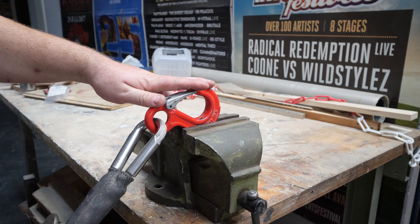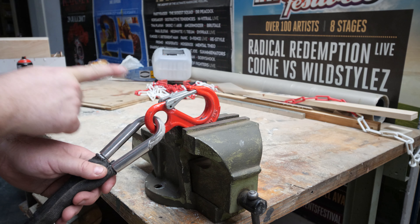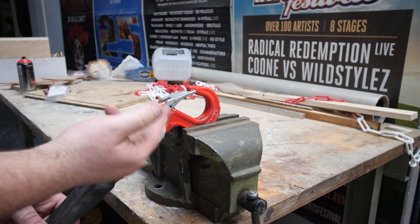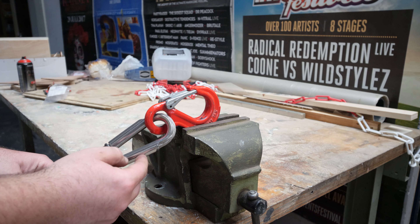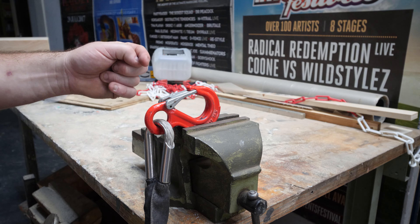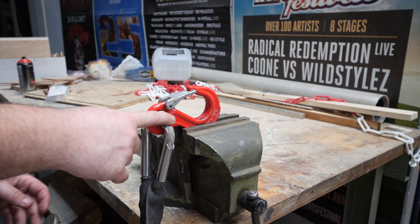Let's install the new hook on my winch. The small winch hook is directly attached to the Seilflechter rope, so you cannot save this hook — I need to cut it off. But if you talk to Seilflechter at shows like Abenteuer Allrad and take your rope to them, they can undo the rope, remove it from the sleeving, and replace the hook for a bigger one if needed. But I like this hook and I'll just make my own extension on it, so I can just remove this hook and throw it away. I can use an angle grinder to cut it off, but then you might damage your rope, so I'll try a different method first.